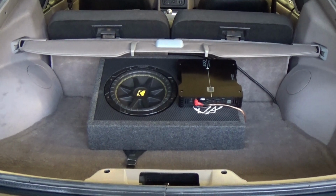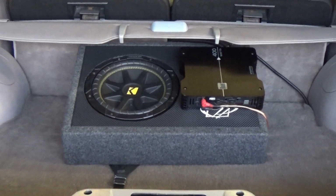So today on Bird's Garage, we got a '92 Mustang project car back in the shop, and we're going to upgrade the electrical system. These cars had a very low amperage output from the factory, and they can't support all the modern things you want to do with one of these Fox body projects. Electric cooling fan, add a subwoofer from the trunk, which we already have. We've got some other accessories installed on the car that we're actually at about its charging max.